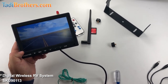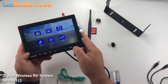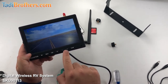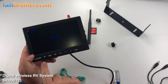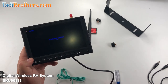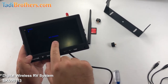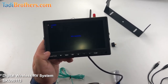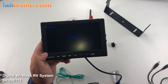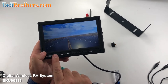Now as for the menu itself, if you enter the menu, here you have the pairing, which we showed you. But I'm going to show you how to move it back to channel one. First you've got to move to channel one, where you see right here. Now I'm going to enter the menu again, click on the pairing button where I'm going to see the countdown, and I'm going to push the little red button. You see no signal here — give it a couple of seconds while it negotiates the settings; sometimes it can take a little longer. And then in about five to ten seconds you should see an image. And there you go — now we have the image right here.